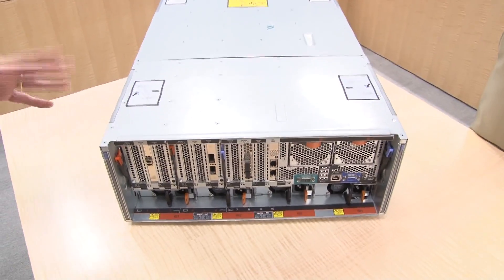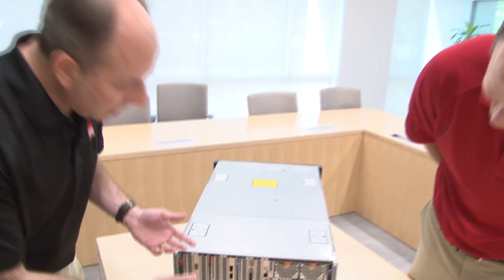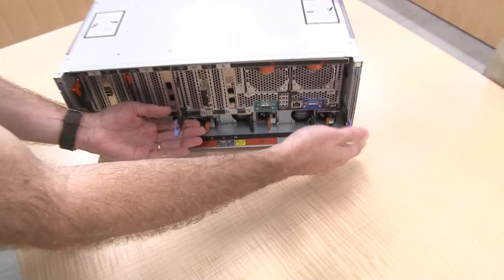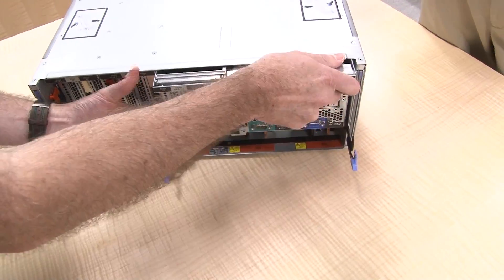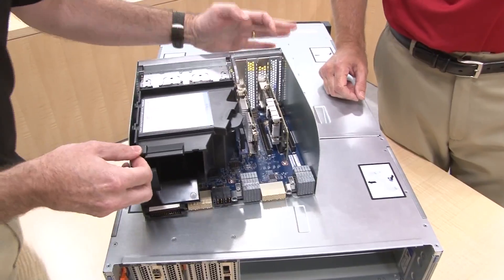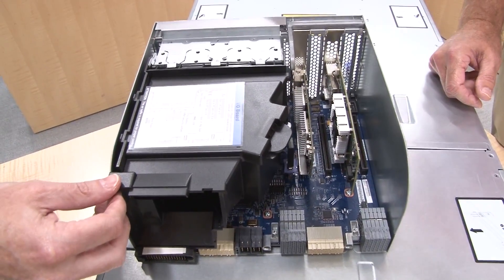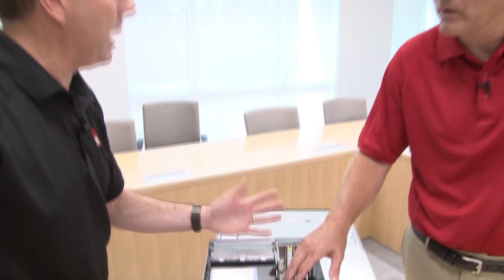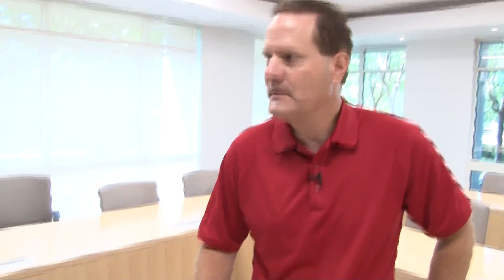We also support 900-watt power supplies for smaller configurations. So let's look at the primary I/O book. The blue handles indicate this is not a hot-swap component — remove the power before taking these out. This is the primary I/O book, and it has four PCI slots: three are regular standardized PCI slots, and then there is a unique Lenovo ML2 slot. The ML2 adapters can save quite a bit of cost compared to standardized PCI slots, and there are a few additional features offered with it. Cost savings seems to be the biggest benefit.